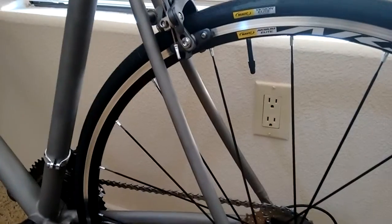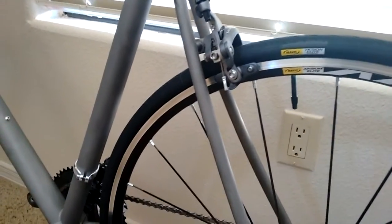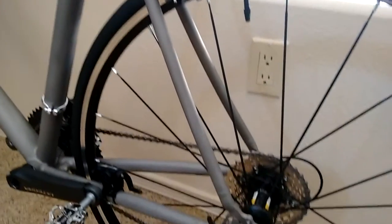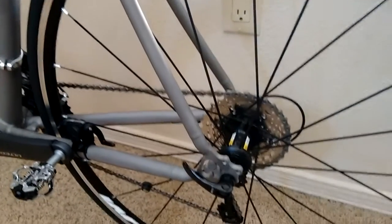The seat stays are curved for flexing for the ride because it's a Sportiva, so the geometry is a little different — the chainstays are a little longer. The quick-mount fenders don't fit great on the rear, but you can finagle them a little bit. I actually bolt to the fender dropouts.